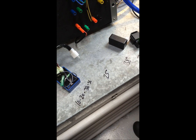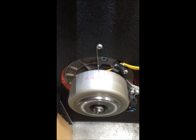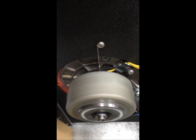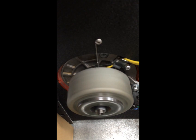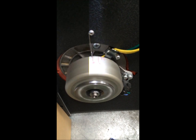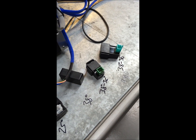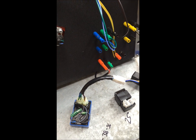Bill will try our CDI — this is the blue easy start. We'll fire it up, back to the five pin. These are all the AC powered ones. Let's try this: 20 degrees, fast ramp up to 38 degrees. Once the revs get up, it backs off slightly. Really ramping up. Having this sort of CDI makes it so easy to start compared to any of the others that are just way too much advance through the range. These will follow the revs — you pretty much want full advance when you're at about 3000 RPM.